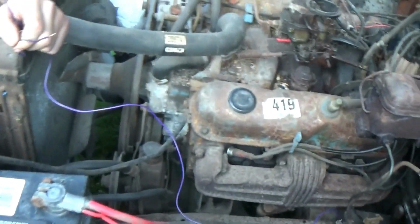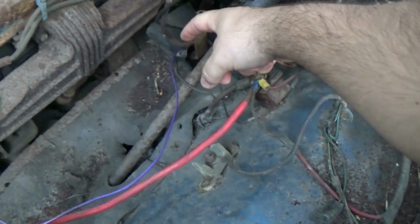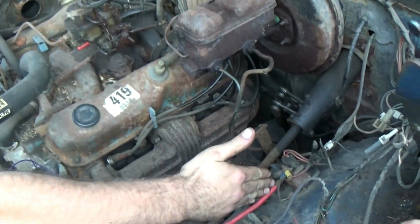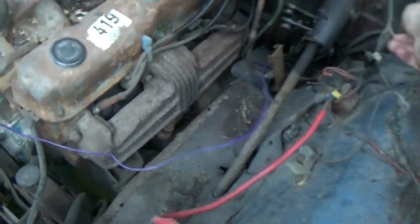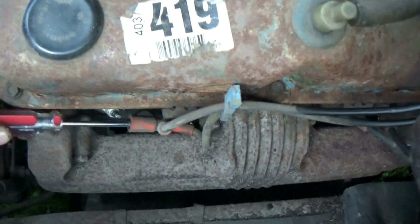For the meme. It spun over. This wire got a little warm. Yeah, that's what, 16 gauge maybe? So the starter works, and it sounds like shit like every Chrysler starter does, so... I was trying to jam the wire onto this post. So somewhere between this and there, nothing's happening, which I'm guessing is probably somewhere in here. Did I have the key on?